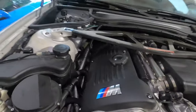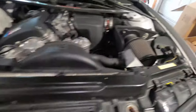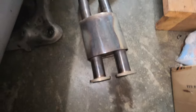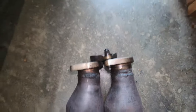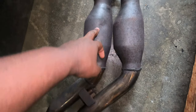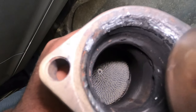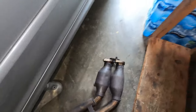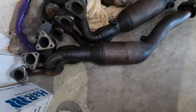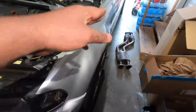This is day three. As you can see, I've mounted everything — the headers are in and I put everything back together: the shield, the coolant tank, secondary air pump, everything is there. But on the bottom, I still have section one out because I'm still stuck with that one bolt that is not coming out. I'm thinking I might take this to a shop for them to remove it. After further inspection, I see that these two are actually not resonators — this is the only resonator on this system. The other ones are cats, because when I look inside I can clearly see those cells, maybe 400 cells. I'm not sure why any of the previous owners had two extra cats on the car, because I already had the factory cats that came with the headers — that was overkill. But now these are out and I'm only going to have those two cats installed once I remove that one bolt.